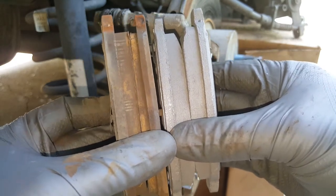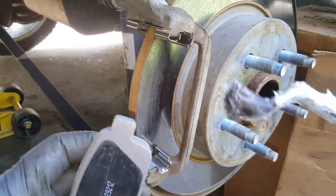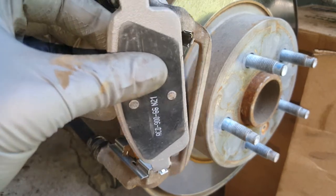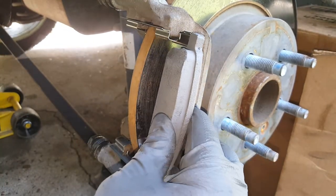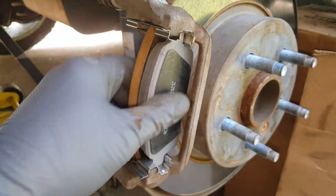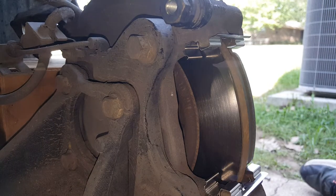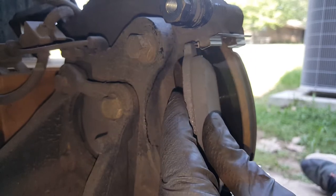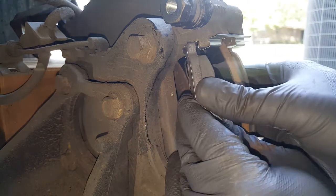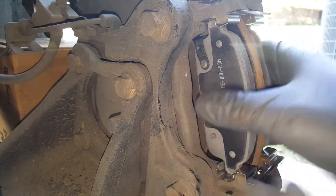And with the pins unseized, maybe these will operate a little better. I like to take a little bit of silicone and just put a little bit right on those contact points. I found I have to go in at an angle because they're really tight. So I start out like so, and then I just twist it — you can tell how tight they are. And again we've got a little bit of that silicone on those contact points, so I'm going to do this one the same way even though I can't see as well back here. We're going to start it in at an angle and then try to twist it, just like that.